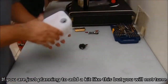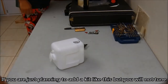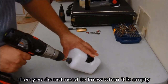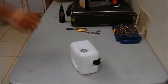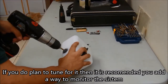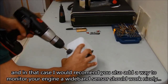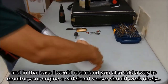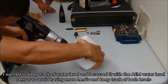Keep in mind that this is not a 12-volt trigger system on its own — it needs to be used with an existing compatible system. I connected it to the AEM's low-water sensor so that either one triggers the warning if water is low. If you're modifying your car, you should add an air-fuel ratio gauge and a system to monitor your water level. If you tune your car for water injection and the water runs out, your car won't have it and you may cause damage.